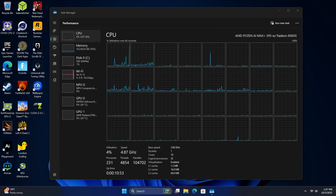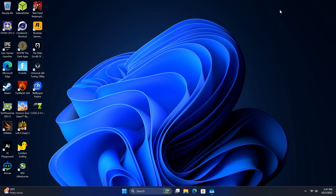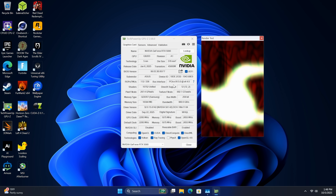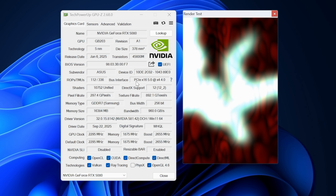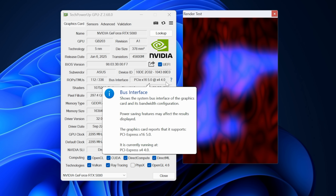Here's what we've got running on this system: the AMD Ryzen AI Max Plus 395, paired with a Radeon 8060s iGPU — but we're not utilizing that today because we have the RTX 5080 connected over USB 4v2 using this Thunderbolt 5 dock, with 16 gigs of VRAM. Out of the box this card should work with PCIe x16 5.0, but using the Thunderbolt 5 eGPU dock it's only at x4 4.0, so we do lose a bit, but we're still getting really good speeds compared to Thunderbolt 4 or USB 4 v1.